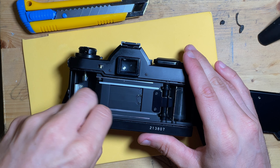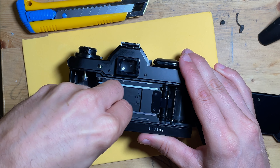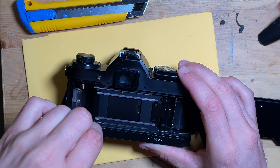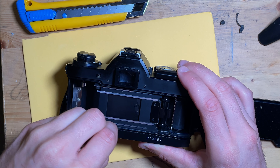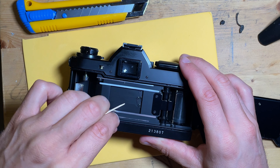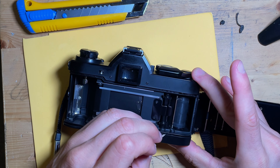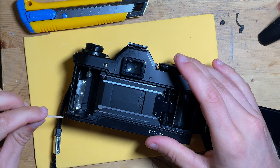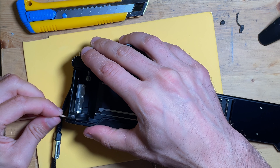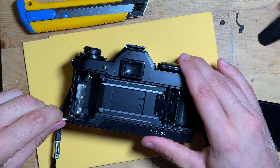You want to make sure you do a really good job cleaning out as much of the old gasket as you can. If you have any solvents, make sure they're safe and won't ruin the paint job. The good thing with this wood scraper is you don't have to worry about scratching anything, because the wood will get damaged before the camera does. So I'm just scraping away — I did not expect it to go this fast, this is amazing.